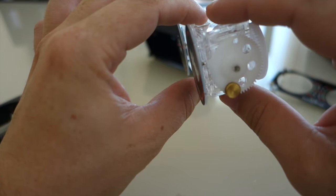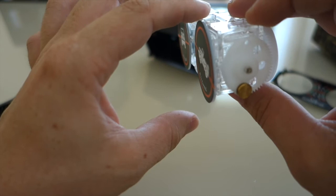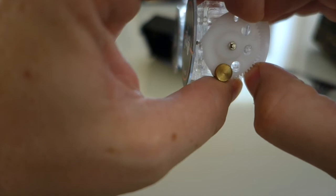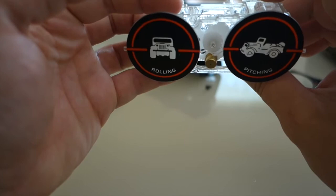The way it's going to be sitting is at about this angle. What I'm going to try to do is move these two gears in relation to each other so that in this position my pitch indication is at the proper angle. What I was able to do is apply a little bit of pressure to the gears, pull them apart and move them. It literally took maybe two or three notches, and now I have the angle that I want and it's going to be centered properly.